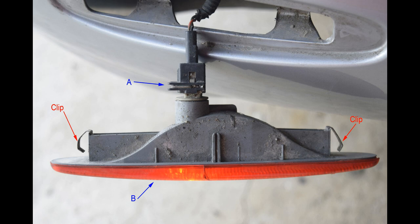I'm going to start with the rear side running light, in which I'm going to substitute an LED for the T10 filament bulb. This light has metal clips retaining the lens, which is one reason I don't mind removing it. I'm not going to do that with some of the plastic-clipped lenses because over time those plastic clips become brittle. By putting LEDs in, I should never have to remove them during the life of the car. To remove this light, crawl under the car, be careful of the muffler, depress the clip on the left and the rear clip, and the lens should pop out. Then grab the bulb holder and turn the lens about a quarter turn counterclockwise to access the bulb.